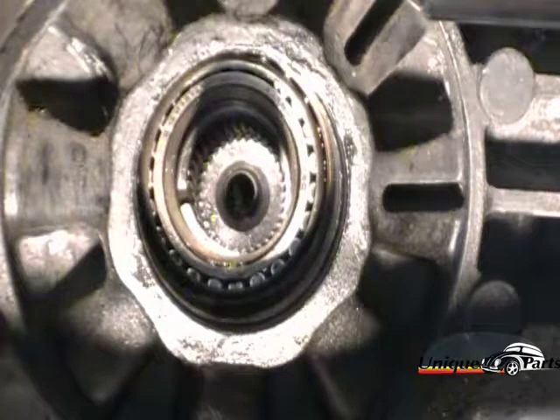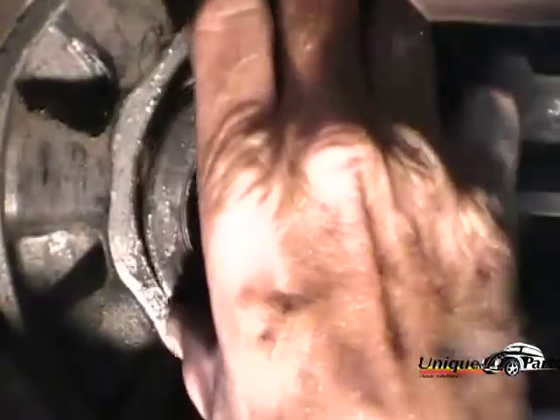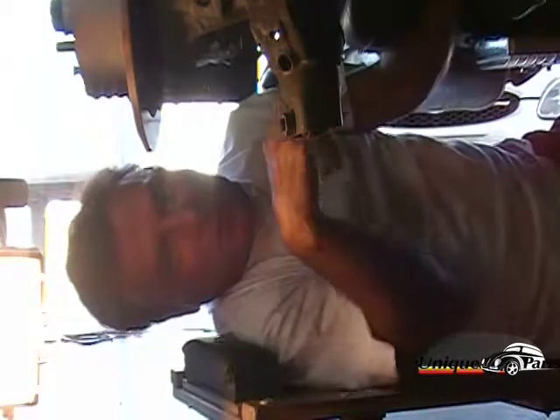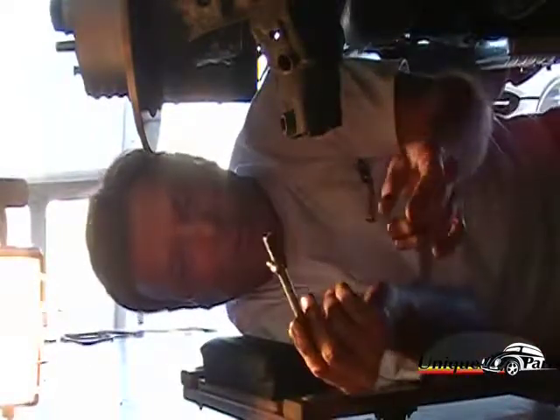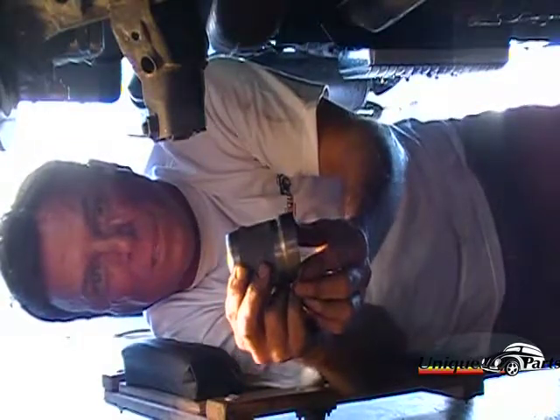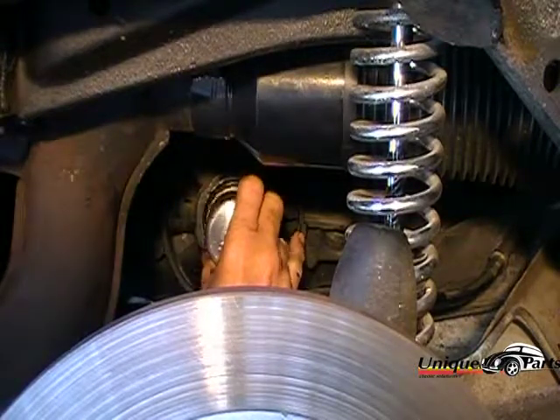Now we want to reinstall the new seal. Here's the new seal. I put some oil on the outside of the seal so it's ready to place into position. Just press it in so far like that. Now we have to draw the seal deeper into the case, so we have a special tool to do that. We put this bolt screwed into the spline shaft, and we use the seal installer which is already calibrated to only go down 375 thousandths. We place this tool over the seal — that is the diameter of the seal.